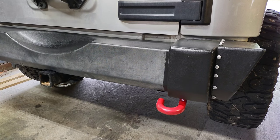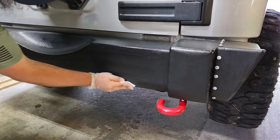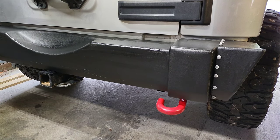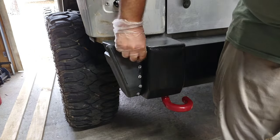It's a chemical, and it is a very strong chemical, so they have chemical resistant gloves in the box. Once your product is applied and you're happy with it, just stay out of direct sunlight for one hour, don't drive it for an hour, and keep it dry for one hour. So pretty much just leave your vehicle sit there for an hour to let the product settle in and cure into the surface.